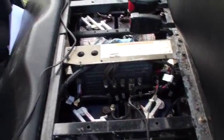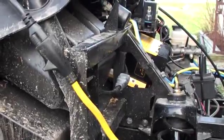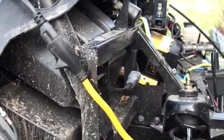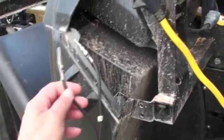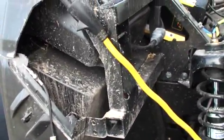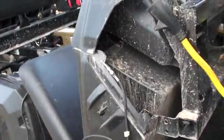Changing the algorithm is a good first step. At least you can check and see what your algorithm is, because if it's set to 73 you'll definitely want to change it to 71 or something. Some people change it to 11, but I'm going to try the 71. All you really need to do is open your hood, connect your charger, and look up in there and see what it says blinking on the side. If it's blinking 71, that's what you're on. If it's blinking 73, you should probably change it. It's not too hard — you just need a little jumper wire, and you've got to be right there, so that's why you need the jumper coming over here. Just simple alligator cables and a little piece of zip cord — really easy to do.